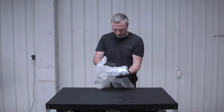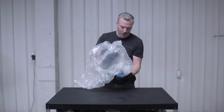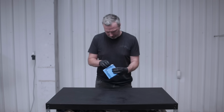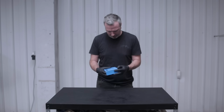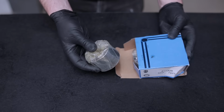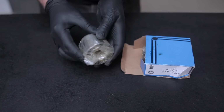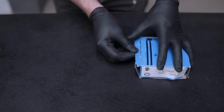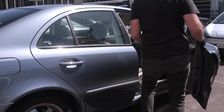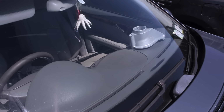I am now desperate to get any little job done while failures beset the project on all sides. These are the very expensive rear wheel bearings. Thank you, Lotus, for using roller skates from a car that was never going to generate a healthy aftermarket parts supply. I've read that if you heat the aluminium rear hub castings and freeze the bearings, they'll nigh on slide into the hubs. So the bearings have been in the freezer for weeks, and the hubs on the dash of the car in the summer sun for about an hour were actually too hot to hold for more than a second or two.